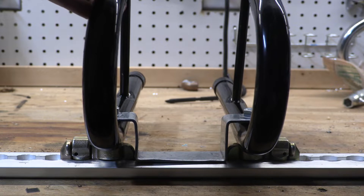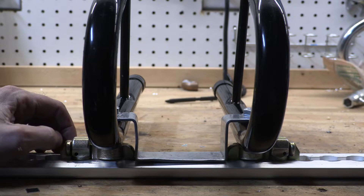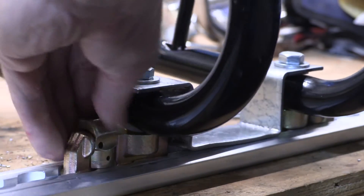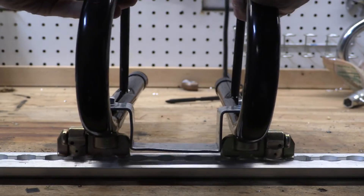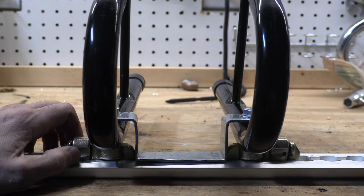I think I'm going to make one more of these, and then I will install them in the Sprinter. But I wanted to show you guys what I created using a $20 part from Amazon — this very cheap wheel chock — a piece of steel from Lowe's, and a couple bolts that are fine-threaded to match the double-studded guys. The links will be in the description for all of this stuff if you wanted to try to create your own to work for the L-Track. Since the E-Track and X-Track and some of those other tracks have their own wheel chocks, I thought L-Track should as well. So here you go — tell me what you think in the comments.